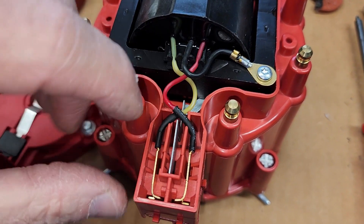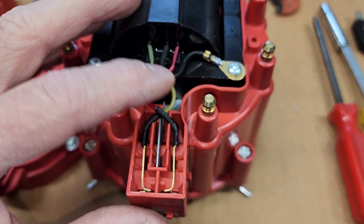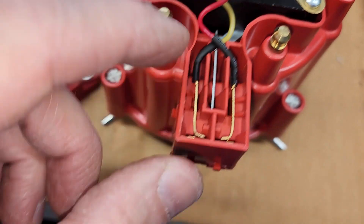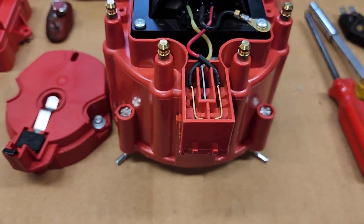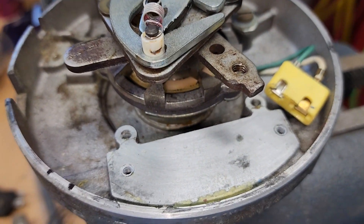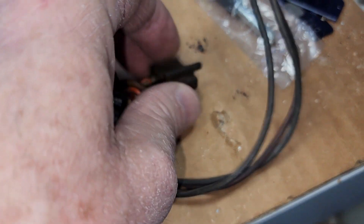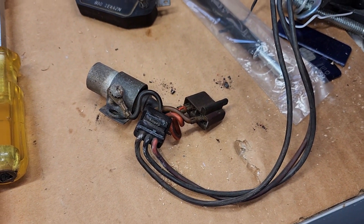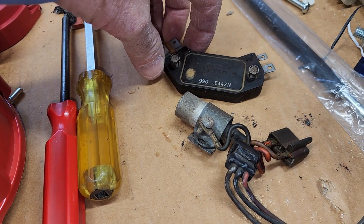Make sure you've got your ground in there — this ground strap that's down in here. That's something people miss. Here's the ground wire coming off the coil. That ground strap goes underneath the coil and creates a grounding system to the tang that's part of your plug-ins when you snap everything back together. New rotor. I found that the parts inside don't look that good — some of the plastic connectors were cracking. So I've got a new one to put in there. It was a good time to go through everything.